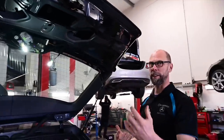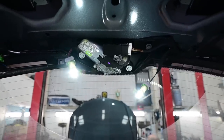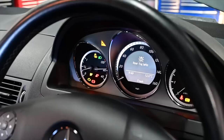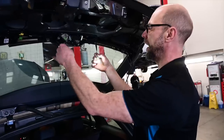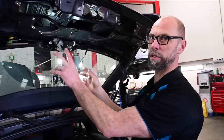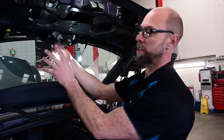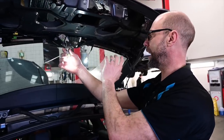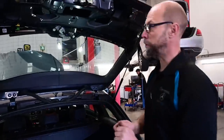They are polarity sensitive and they went in quite quickly. It hasn't put a warning on the dash, so we've got away with it this time — these will now last longer. Thankfully these ones haven't thrown up a warning about voltage, which does sometimes happen. We'd disconnected a fog light bulb just to prove the point of whether these LEDs would put faults in the system, but these ones are part of the good circuitry bulbs and haven't. They are designed to give the right resistance so it doesn't upset the car's bulb monitoring system.